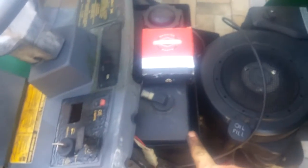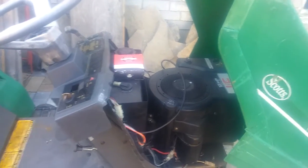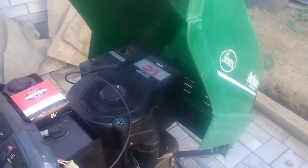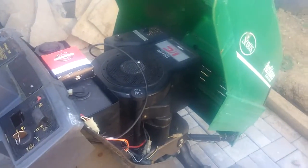Also, I figured out how these gas tanks come out finally from taking apart the Craftsman. They're actually quite easy. If I would have known that before when I was monkeying around that 17 horse, I would just pull the gas tank out instead of always unbolting the engine. But I thought they were a lot harder — it's actually just three bolts on each side and they come out. And this wire here I believe is for the hour meter — it's hanging down, I'll tuck that back up eventually.